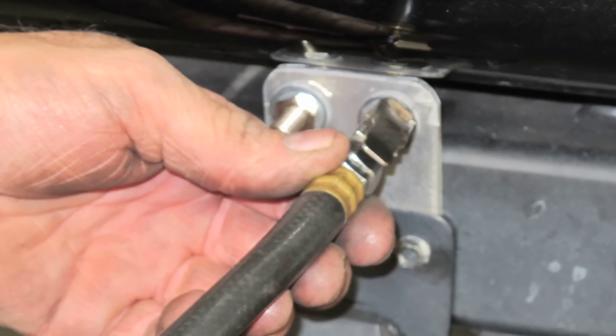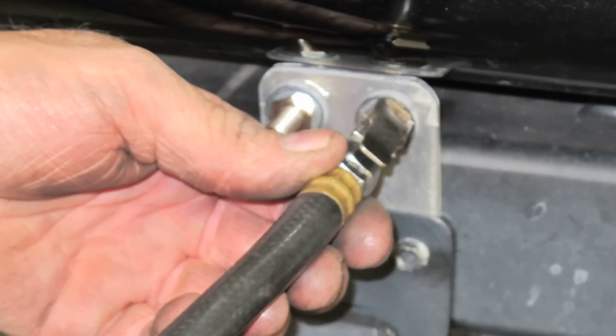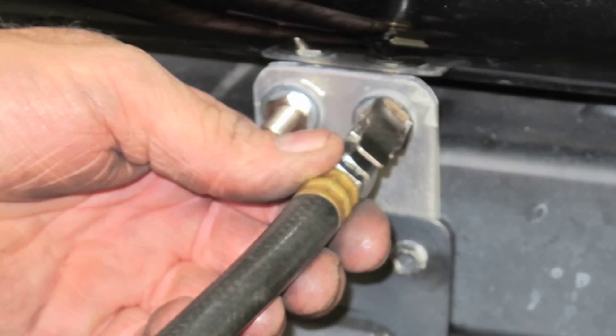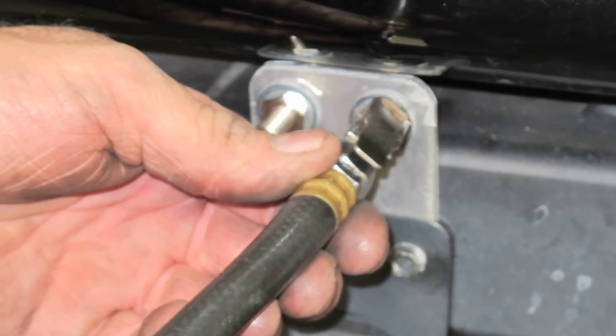Inflate the left and right air bags at their respective valve coupling. Inflate to the recommended minimum of 10 psi. This pressure is to be maintained as a minimum to avoid any pinching of the bag during normal coil operation whilst driving. Any such pinch could cause an air leak from the bag.